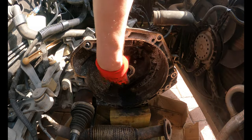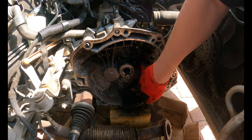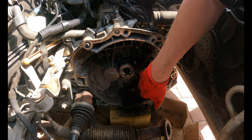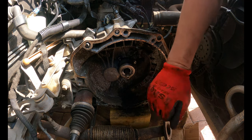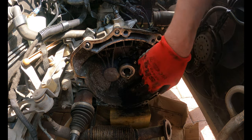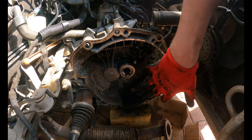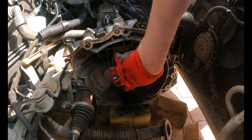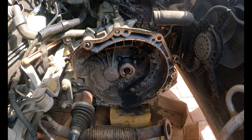Okay, so with a bit of adjustment up and down, managed to get this line up. There are three little tabs, one behind here, one behind there, one behind there, and they don't line up. From this Transmet kit I got, they didn't line up with the groove that's up behind the plate, so I trimmed them off very, very carefully, not getting any debris or anything into here or on the back. So they're like three little plastic tabs. I should have taken a photo, but I was just test fitting it, got it right. I was like, right, I'm gonna bolt it up now. But with those tabs in place, it doesn't sit flush to the back. So if you buy the Transmet kit like me, you're gonna wanna change that.